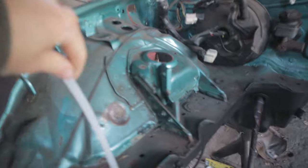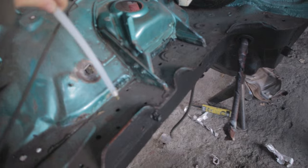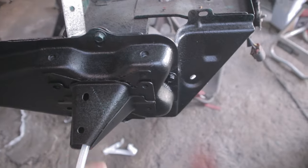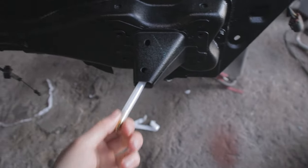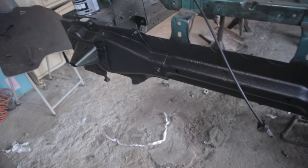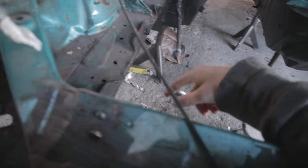You can put it in the rails - we've got a spot here we can spray in, spray in, spray in here, and then we can get it all the way through the actual rails like this. Just roll the wand all the way in and cavity wax the whole inside, and that should protect it, stop water sitting in hidden places, keep it protected for longer.